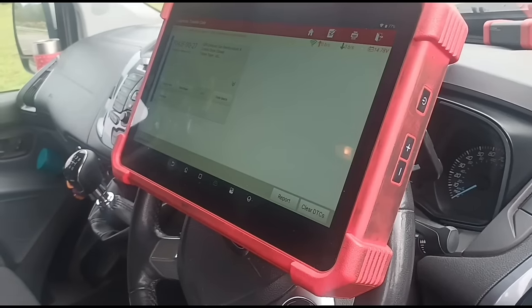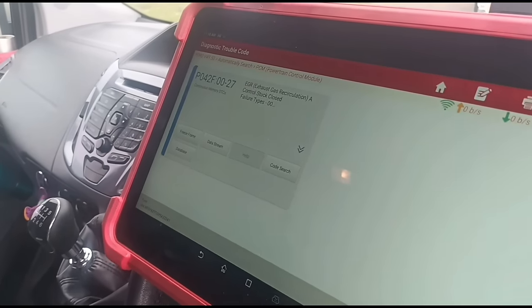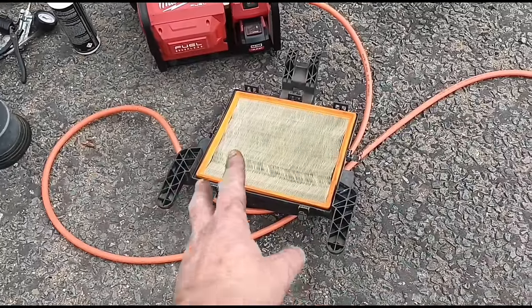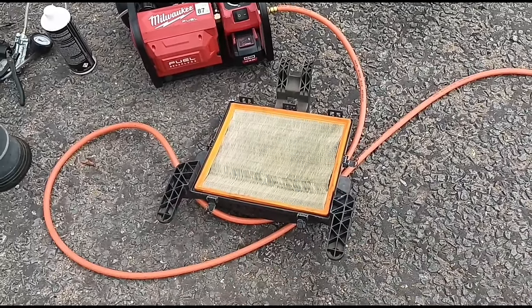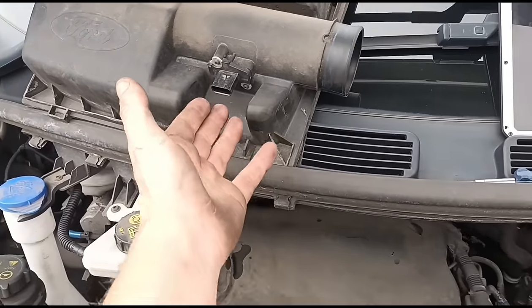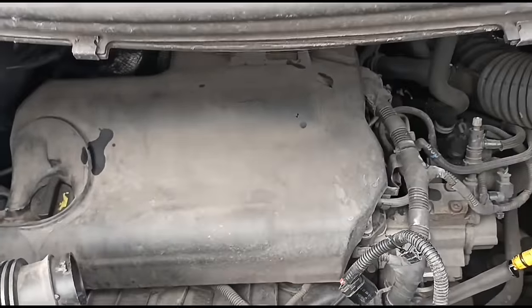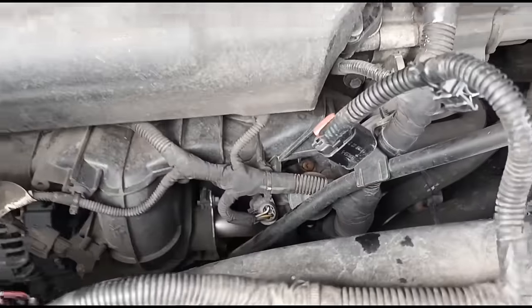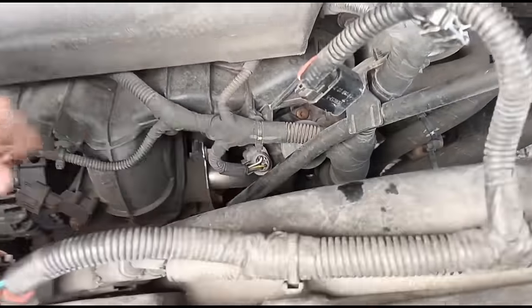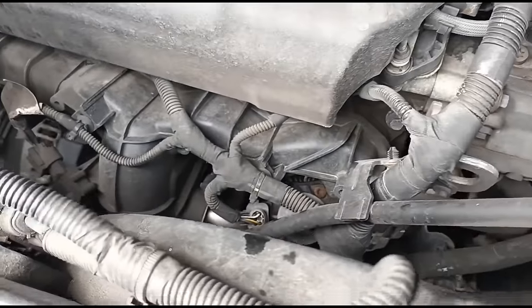The vehicle's now woken up, tried to open the EGR valve, and realized it's stuck. So we're going to get that replaced. I've already removed the air box, which is pretty simple — it just pulls out. You remove the top of the air box, disconnect the airflow meter which pulls out, and you can pull the bottom half out as well. The EGR valve is located just right here.